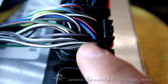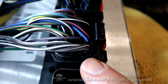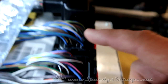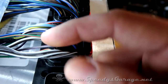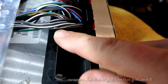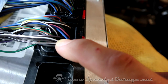The reason we removed that cap is so we can actually see the pin numbers. Don't go strictly by the wire color — you want to double check via pin number. You can see this ends in 10, so that's pin 10, then 19, 28, 38. On connector three, the one we're interested in is pin number 26, which is the green with orange stripe. The reason I'm telling you not to count on that being green with orange stripe is because there happens to be another green with orange stripe in there — so if you didn't actually take the cap off and count the pins, you would likely grab the wrong wire.